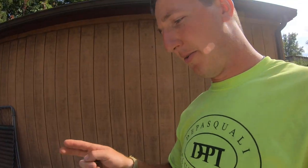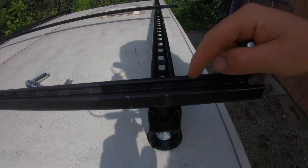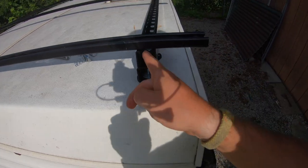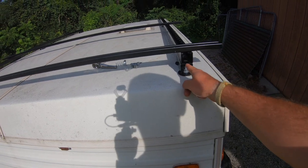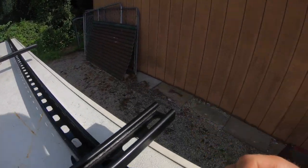It's important when you go to cut these, really, I guess when you go to bolt your big strut on there, you need to make sure that your shallow strut will line up with the hole. The holes in shallow strut are 2 inches apart on center, so if you're an even number, your holes should line up. I think it was 70 inches apart from the center of this strut to the center of that strut down there. You just want to make sure that your holes line up in the strut so you can bolt to it.